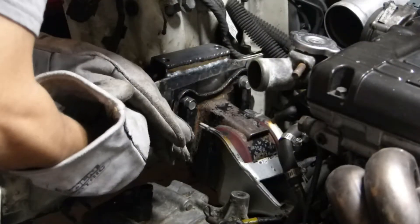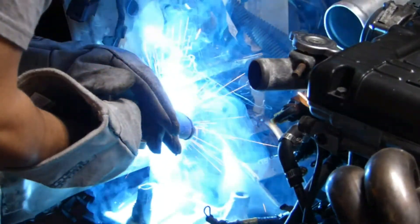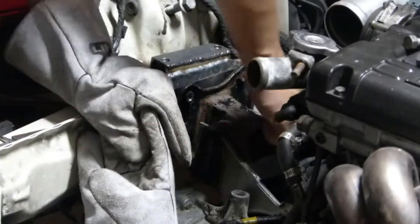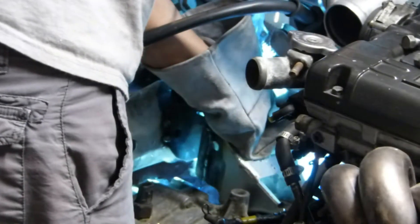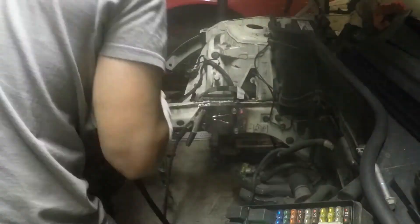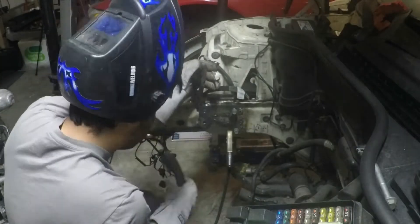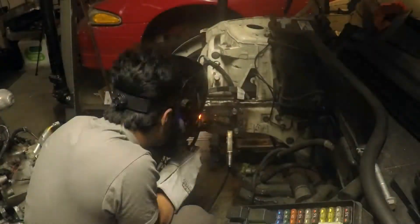Then we get to weld it. We removed the mount to get access for full welds on the inside and outside where we have those relief cuts. This did take a significant amount of time — we had to cut a lot of eighth-inch plate to make additional bracing to the frame rail to take care of some of those gaps. All in all it made a very nice box section and we were able to tie into it quite well — basically 360 degrees welded around the outside of this face, and those reinforcing plates tied in very well to the frame.